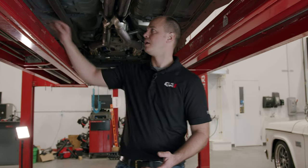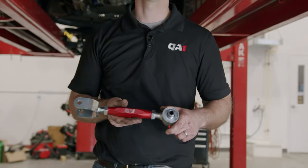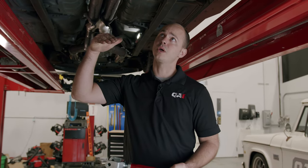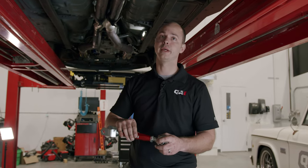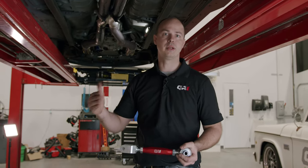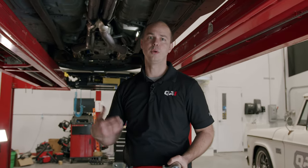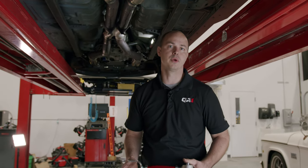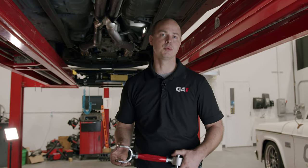Now that I've covered what we're measuring, we need to look at the how. If you've got adjustable trailing arms like these, we've got right and left-hand threads — loosen up the jam nuts and you can actually adjust this on the car. In order to rotate the pinion down a little bit, you would lengthen the upper trailing arm. If you've got a car where you need to rotate the pinion up, you would shorten the trailing arm. If you've got a leaf spring system, you would use shims. Differing types of suspension have differing methods, but in general we're looking at the same type of thing and making similar adjustments.